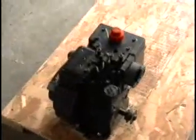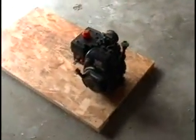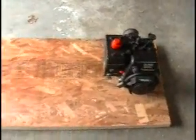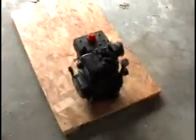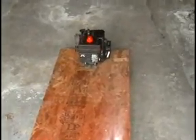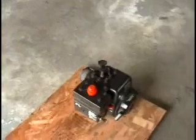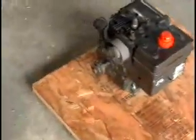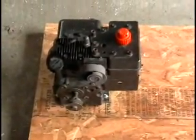This is the 3 horsepower Tecumseh engine we started with the other day. Today is now the 13th of February 2008. I mounted it to a piece of OSB with some 2x4s underneath hoping to dampen some of the vibration. I'm going to start it now just so you can see there's nothing tricky about it. Right now it's configured to run on gasoline only. You can see there's a gas can on there, underneath is my ignition switch, there's my pull start, my throttle, and over here the muffler and the horizontal shaft. So let's go ahead and start it up.